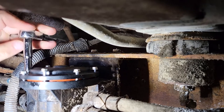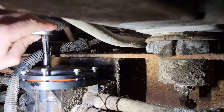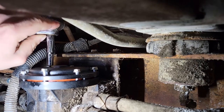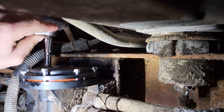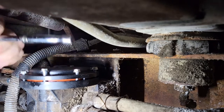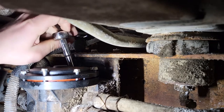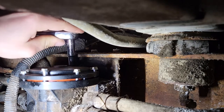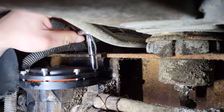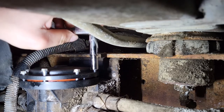Well, this ratchet ain't very good. I don't want a ratchet. This one guy, he wasn't trying to tighten it, but he over tightened and stripped it. Whoops. Watch out. Gentle on this one. Oh, plastic. Alright, I'm just gonna get them all close, and then when I go to torque, I'll go to opposite sides. For now, we're treating it like a merry-go-round.